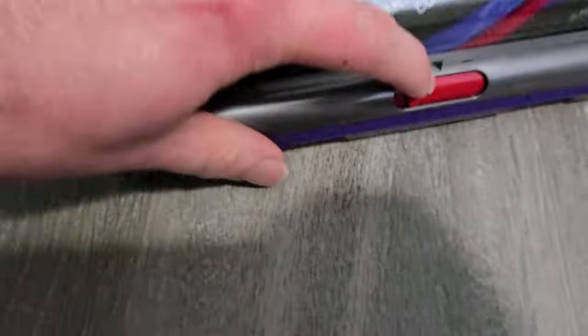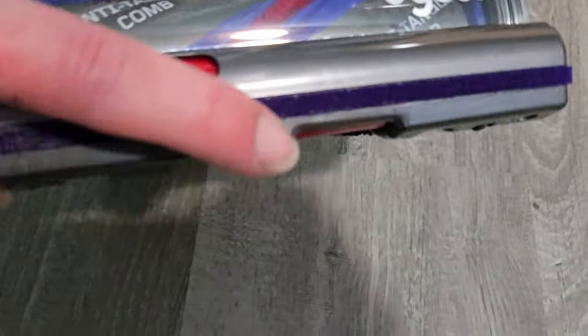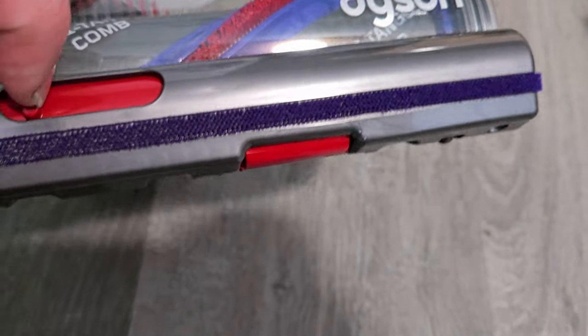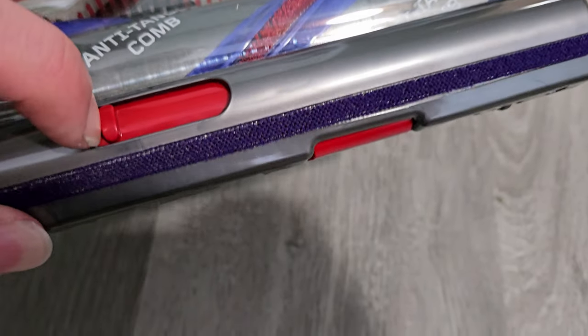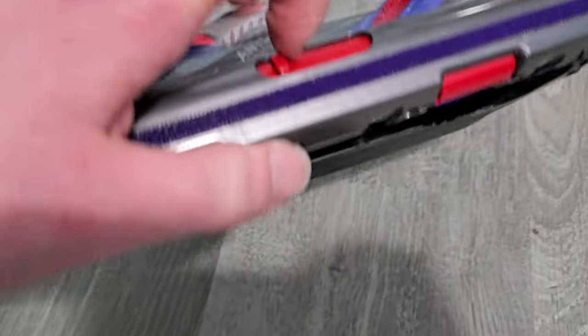And right here, this doesn't provide more or less suction. Well, what it does is it lowers these right here, and then it can provide more suction by doing that. The plus lowers it all the way down. You actually get more suction because no air will get through there. Well, less of it will. And you get the standard, and then minus is all the way up. So you're going to get more airflow through here and less suction through there. So that's what the standard head does.